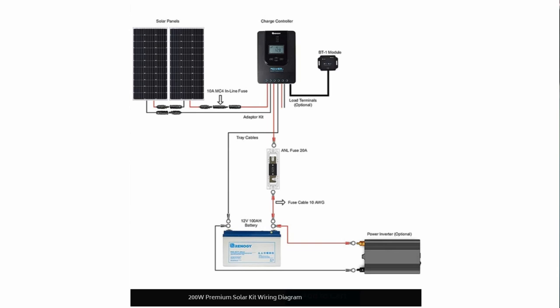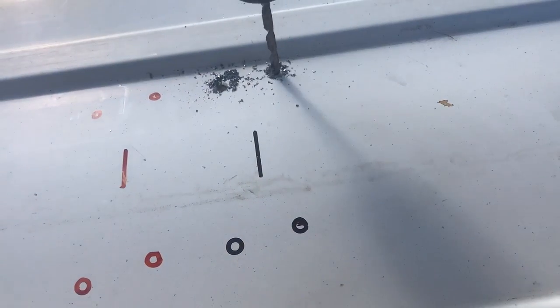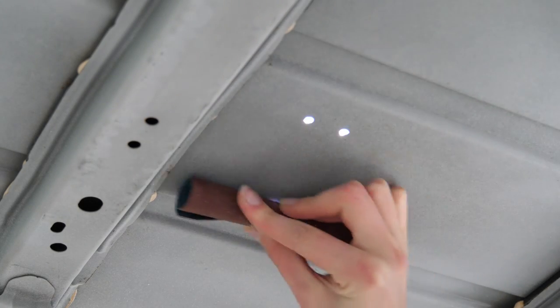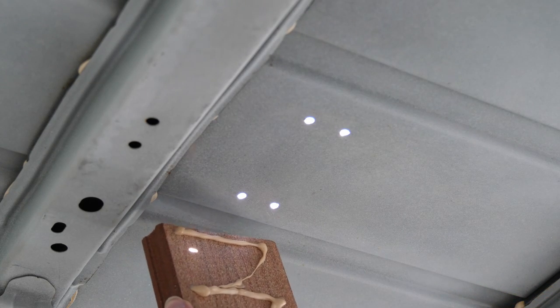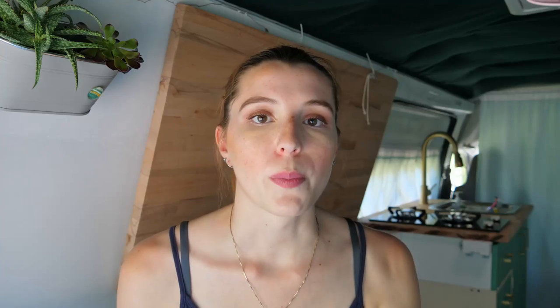The first thing I did was attach the two solar panels to the roof of the van. This was a pretty simple DIY, which started with using the Z brackets and attaching them to the underside of the panels. I then selected the location, which was width-ways in front of my MaxxAir fan — just where the panels fit best. I marked the location of the holes and pre-drilled using a metal drill bit. The next thing I did was take some modwood — recycled plastic made to look like wood — and used some liquid nails to glue this underneath those pre-drilled holes, because the roof itself is really thin and it's not a lot to anchor the solar panels down into, so by creating a block on the underside of the roof I had something more secure that the screws could actually attach down into.